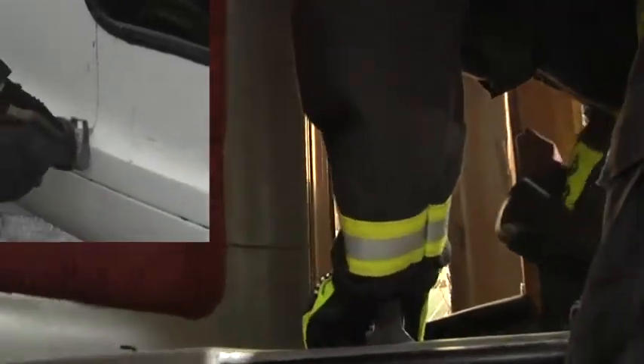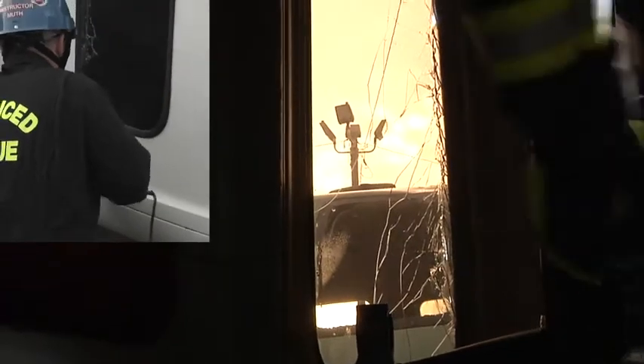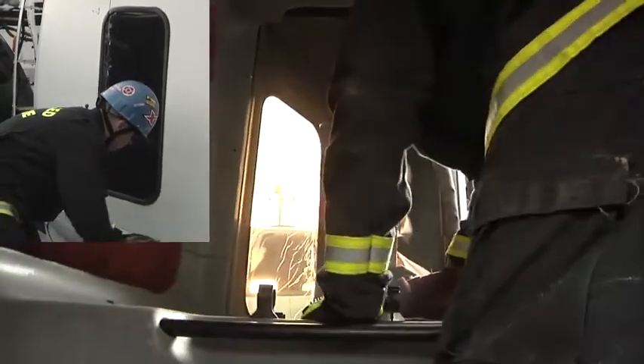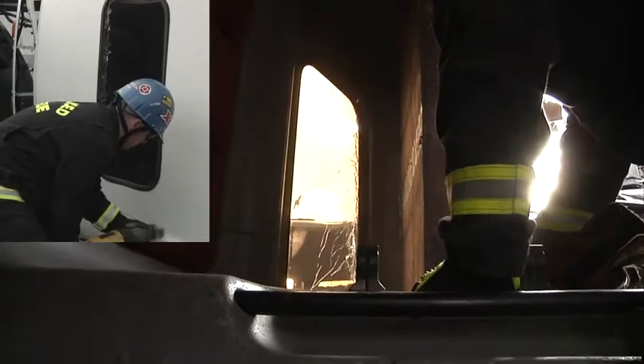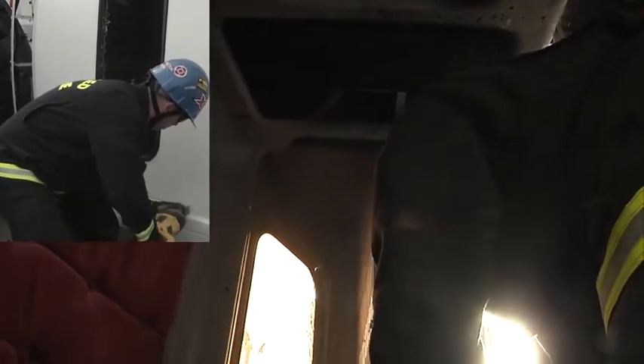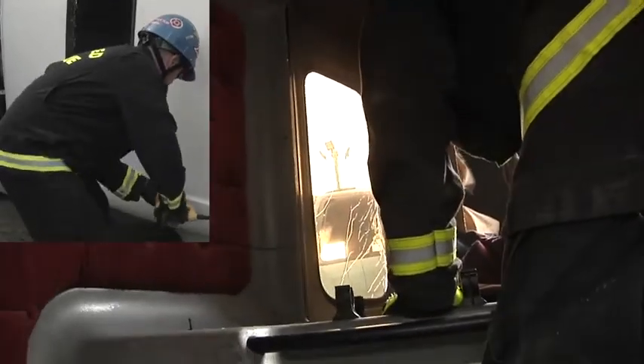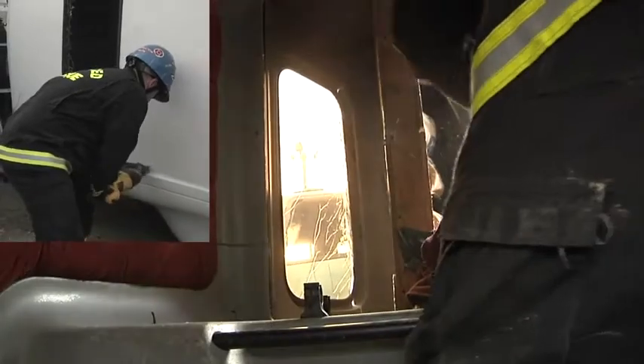Cutting the window out. These guys live in these cabs. You may find some homemade piece of equipment or even some pre-manufactured stuff inside the cab that are going to cause you problems doing extrication. Your interior recon person is going to assess that to make sure that your sawzall doesn't get caught up. We've made access through the top of the cab. Now we're bringing that sawzall back, and with the advent of the Aerodyne, this entire cab can be opened up to give us great access to the interior.